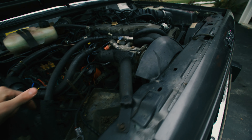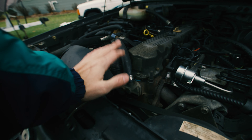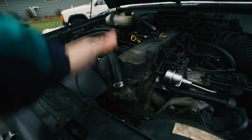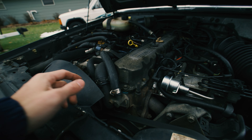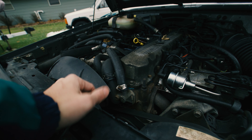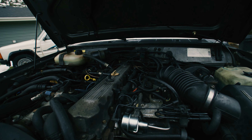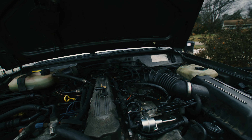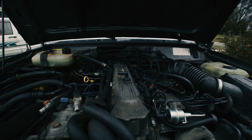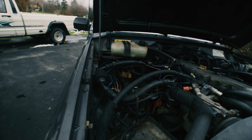I'm going to redo all the wiring, all the ground wires, and add a ground wire from the intake manifold to the body — a body ground that wasn't even on this Jeep. I also figured out the cooling issue: it didn't even have a thermostat. Since it's a Florida Jeep, the previous owner apparently didn't need one. I bought one, threw it in, got all the air out of the system, and now it gets up to temperature. I still need to do an oil change.